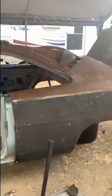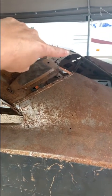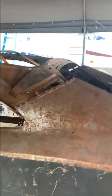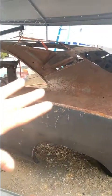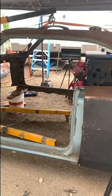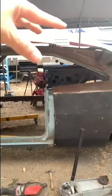I can also go ahead, I've got this tacked on. This back brace here is off of a different Charger. Mine was completely rusted, all gone right in the middle. So I got all this cut in and welded. I just have to finish welding, and then I can de-rust and prime that whole area. Do the same with the roof that's underneath the RV over there, at least on the underneath. De-rust it, prime it, and I can go ahead and get the roof on.